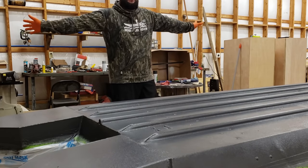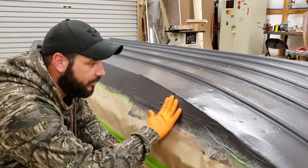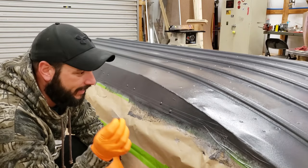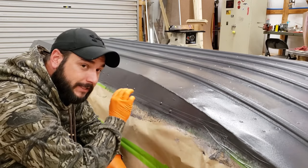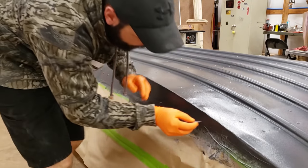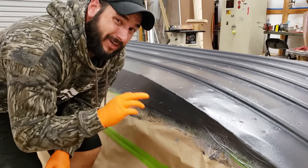That's all she wrote folks - five coats are finally done. I'm going to give this about 20 minutes to dry and then move on to the next step. So we're at the very last step. The last coat's dry, it's been about 20 minutes, it's dry to the touch. Here's a little pro tip - before you remove the tape, get the sharpest razor blade you can, brand new out of the package if you can. Go around all your tape lines right at the edge of the tape and score that tape line. You're not digging in trying to cut through all the layers - just give it a nice clean score line without a lot of pressure. Then run around the boat and do this to get really clean tape lines.